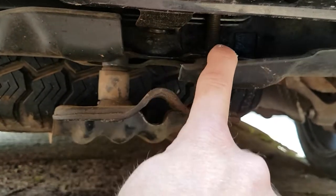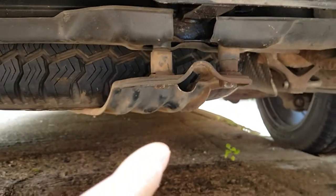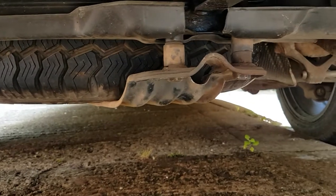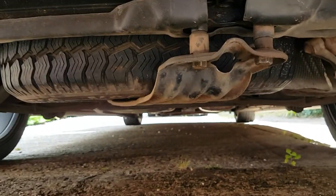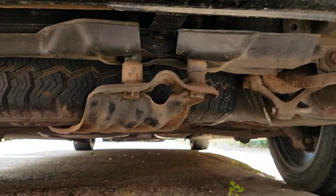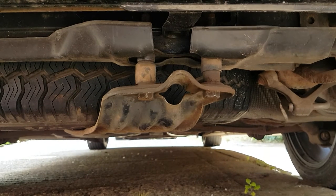Make sure that one is nicely greased up, get some covering on there, and take it off probably about once a year - just make sure you can easily get that off. So I just want to share that tip with you. If you ever need to get your spare wheel off in an emergency, make sure that bolt's well looked after. Thanks for watching, see you in the next one, bye.